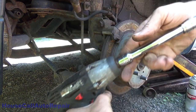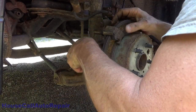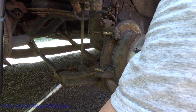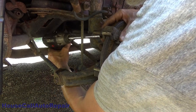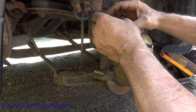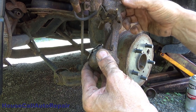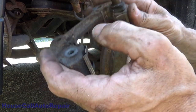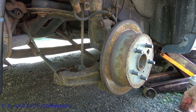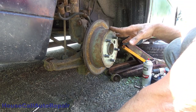This wheel here is a complete mess — the bushings are kind of squeaking and making lots of noise. Now the bottom and top bolts are out. Remove the bracket. Normally we'd be discarding this bracket because we've got a brand new caliper and bracket to go on, but you'll see in a few minutes why we're not getting rid of this one.